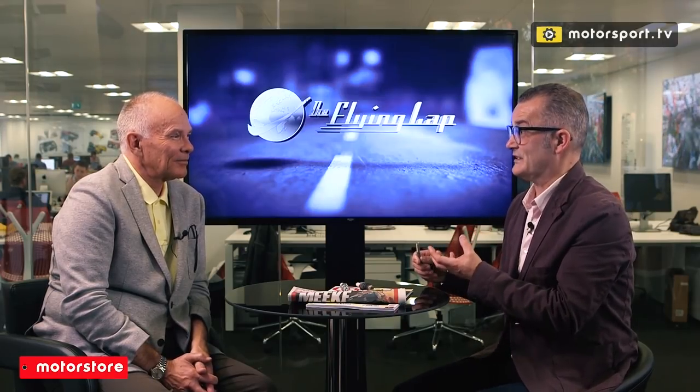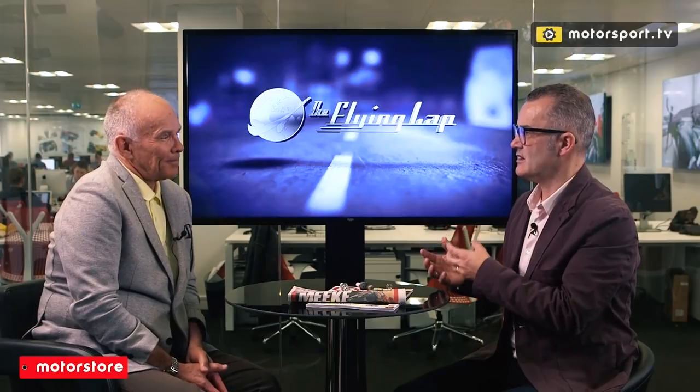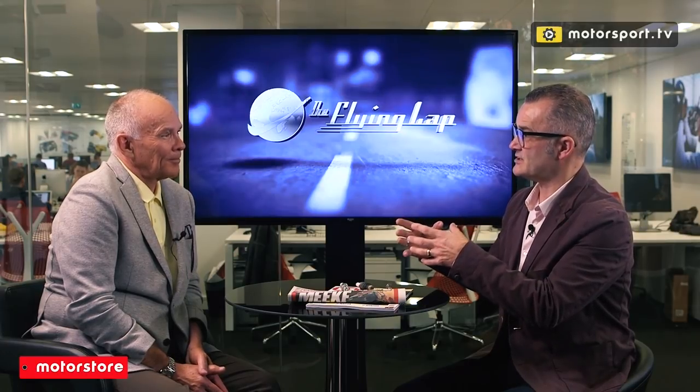That's the conventional tech. Now in relation to research and what happened with Vettel, I've found out something quite interesting. We've spoken many times about what we call pre-chamber combustion technology. Mercedes is one of the types where they have turbulent jet ignition, where rather than having complete combustion within the cylinder, there's a little chamber built into the cylinder head. Combustion starts there with a very rich mixture, and then flames come out of this chamber which ignite the much weaker mixture in the main combustion chamber. This is what allows these current Formula One engines to be so powerful with so little fuel — they're able to run very lean mixtures.